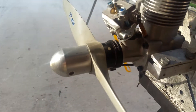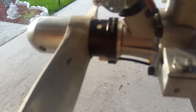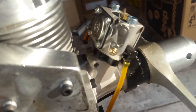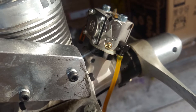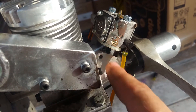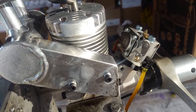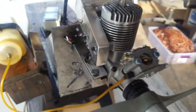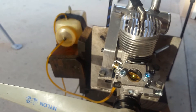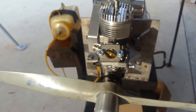Here is the setup again: carburetor, gas carb, magnet ring, sensor ring. The carburetor pumps the fuel by itself. Right here I have a cutout where you can put a barb fitting and connect it to the crankcase with another barb and Tygon tubing, and then it will definitely do the pumping by itself. I played with the tank up, down, left, right just to see if the carb is getting the fuel, and apparently it does. Thanks for watching and come back for more.